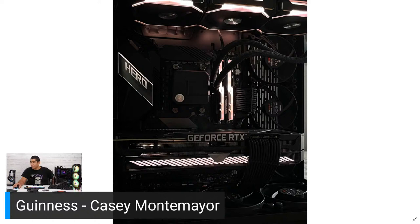All right, so let's see the core components for the system. This is running a Ryzen 7 5800X, an EKWB Basic 360, a Crosshair 8 Hero, 3600 megahertz, 32 gigabytes of G.Skill memory, a 1 terabyte NVMe drive, and then an ASUS STRIX 3080 card. That's all inside an O11, a very popular chassis, with a 1000 watt power supply. Yep, he's actually got not the Silent Wings but the Shadow Wings too, from Be Quiet fans, and also those Uni fans from Lian Li. And then he's got some extensions from Asiahorse.